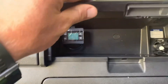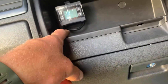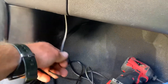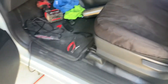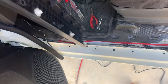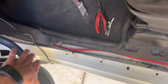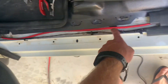I've left this red wire off from here. I've mounted the little LCD screen that comes with it up inside my glove box, so I'm going to be able to have a little monitor there which tells me everything. Just drilled a hole in the back of the glove box and run it down the back. Pulling these trim pieces off is as simple as grabbing here and lifting up — they pull out. Then pull up the rubber which gives you access to push your wire behind there, running it all underneath concealed to the back where no one can see it and it's out of harm's way.